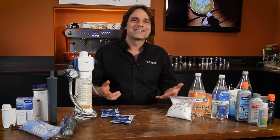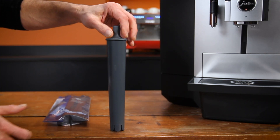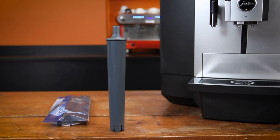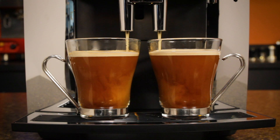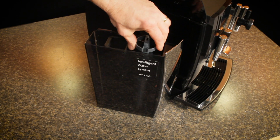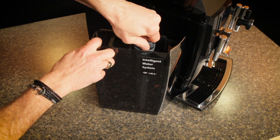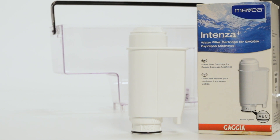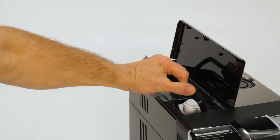So how do you get to water that's good for flavor and reduces or eliminates scale buildup? A few options. For super-automatic coffee machines, use the in-tank filter as recommended by the manufacturer — they reduce water hardness yet maintain a proper mineral level for good flavor. For some manufacturers like Jura, use a filter as recommended and you never have to descale any of their machines. For others, using a filter will extend the time between descaling maintenance by a factor of four or more.